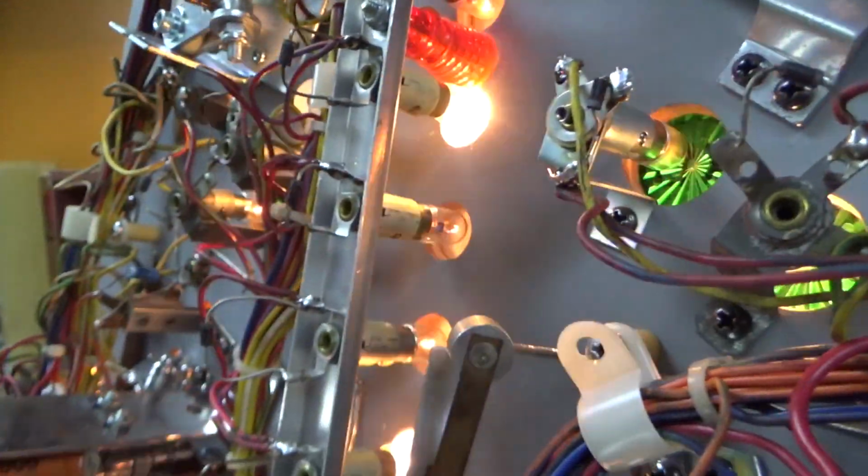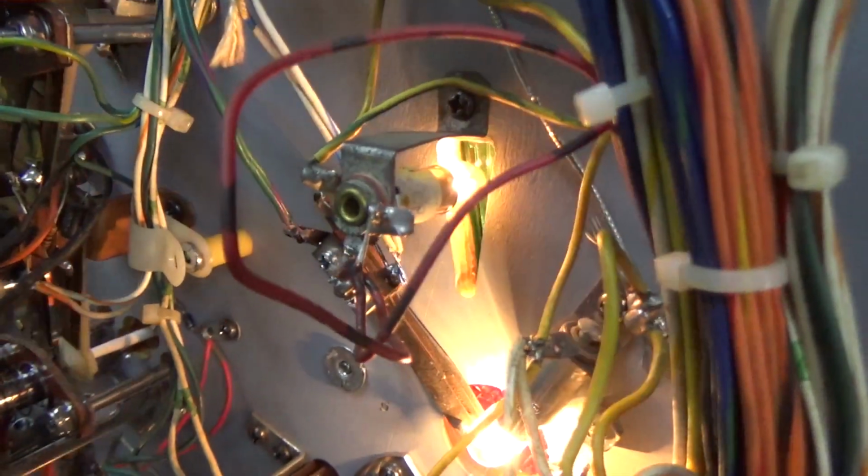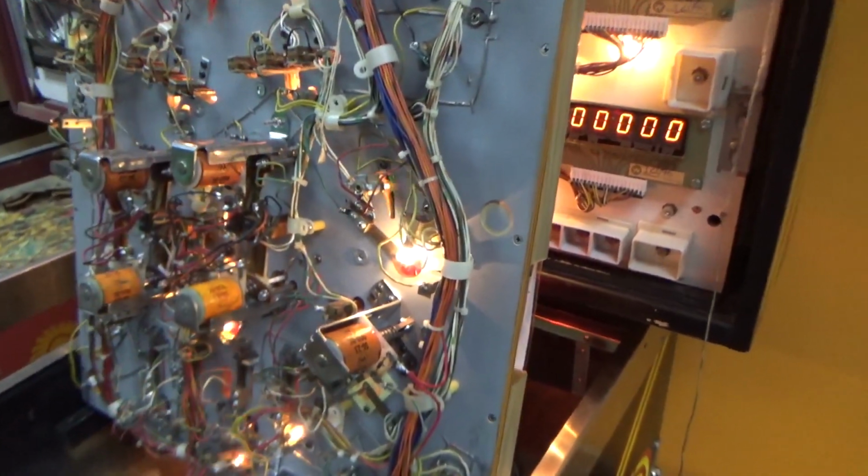Okay, so our number 4, new diode. Tested the old one out of the circuit, and it is in fact open. And then down here the diode was missing. Put in a new one. Bam. Came right back. So every one of the switched illumination lights is now working.